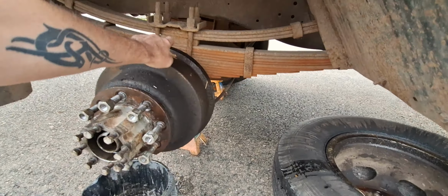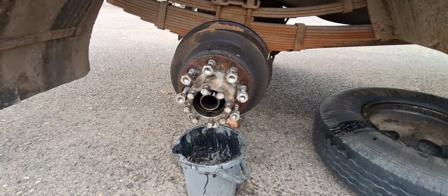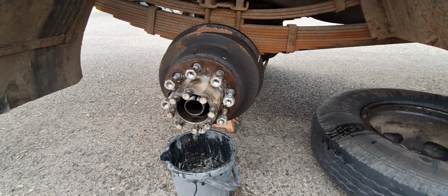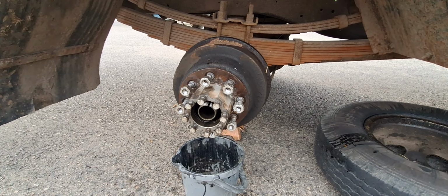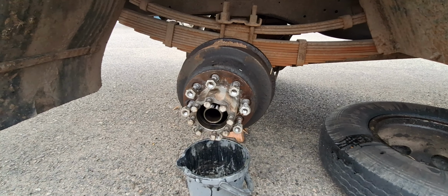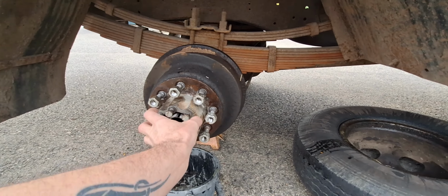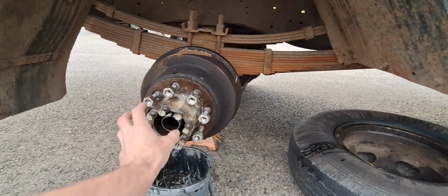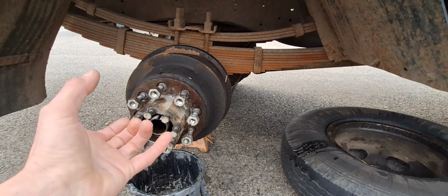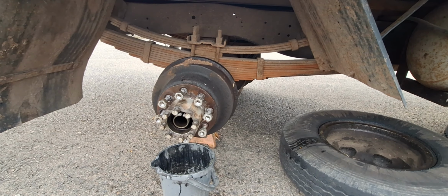Unfortunately, there's a wear lip in here and the self-adjuster, so getting that off is difficult. I did think you needed a special tool for the big hub nuts in the end there. As it turns out, the previous owner used a chisel. So as they'd already used a chisel, that's what I used, and it came off okay. It wasn't actually very tight. The half shaft is inside the workshop, so it doesn't go rusty. You draw the half shaft out with these bolts, and then this just needs pulling off. It literally weighs a ton, and I will get to getting that off later today.